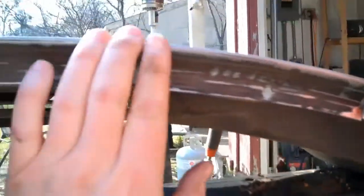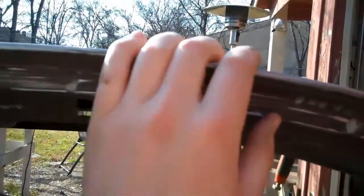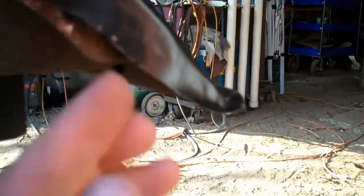One thing I want to mention is here, this is sort of the back side of the fender. This is the side that butts up against the door, and again, this is the passenger side fender. This lip on your patch panel isn't as long as the original, and so I'm not quite sure what I'm going to do there. What I'm thinking is, if I pull this, you can see a bit of a gap, and it's about 1/8 of an inch between the original edge and the new edge, and it's not a good idea to build up body filler on an edge like that, because it cracks off real easily.